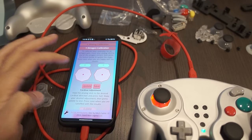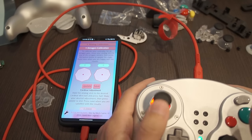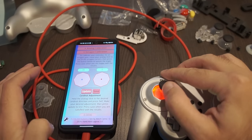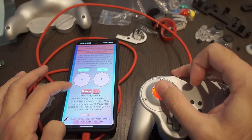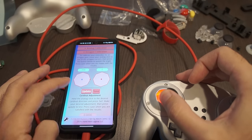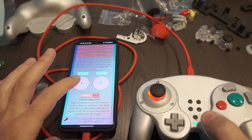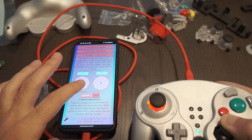Let's get into the octagon calibration, because not every gate can be perfectly made — there's material shrinkage and things like that. What you can do is hold the stick to each cardinal and hit update. Right now this is at 36 degrees rather than the 45 degrees it should be for that angle, so you hit update and now it's at a perfect 45. That scales properly. We can go and do this for each cardinal, and you can do the same for the right stick. This calibration applies to all modes.